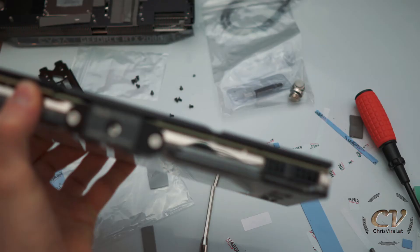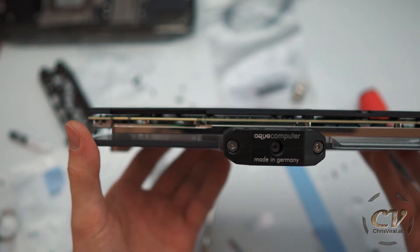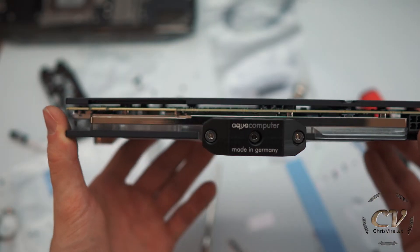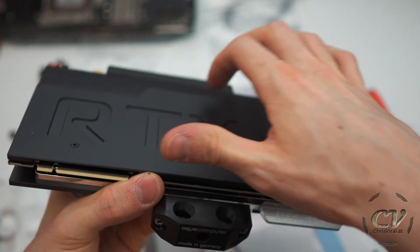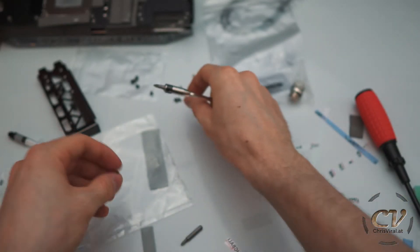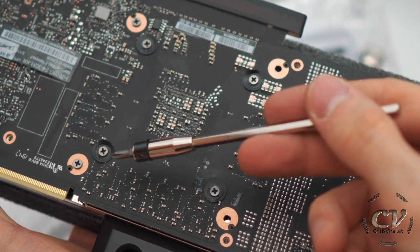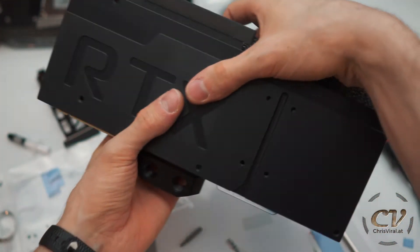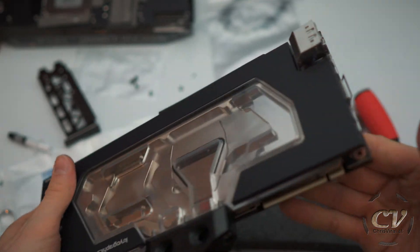Why isn't this fitting — this is by far the hardest problem of the build. Inside the graphics card there are these four screws with springs — they are touching the backplate. Also it's looking bent, it's definitely bent. So I'll open it up again, remove the springs, and instead of those screws use the regular ones that came with the cooling block — this one, this one, this one, and this one. These got replaced and they should fit without a problem. And here we go — it's done! Backplate and water block.